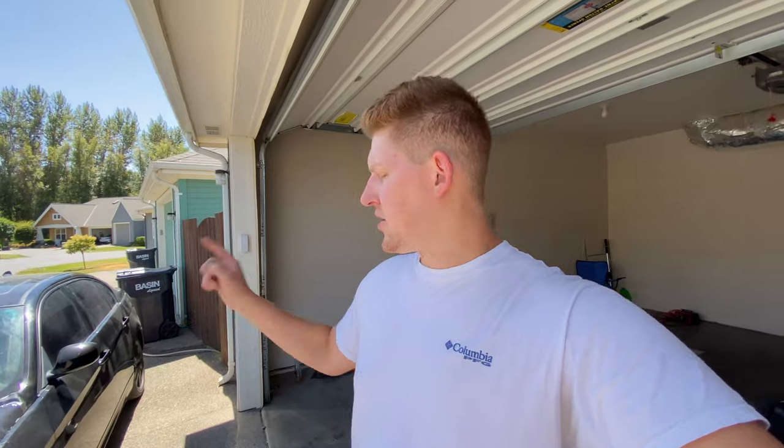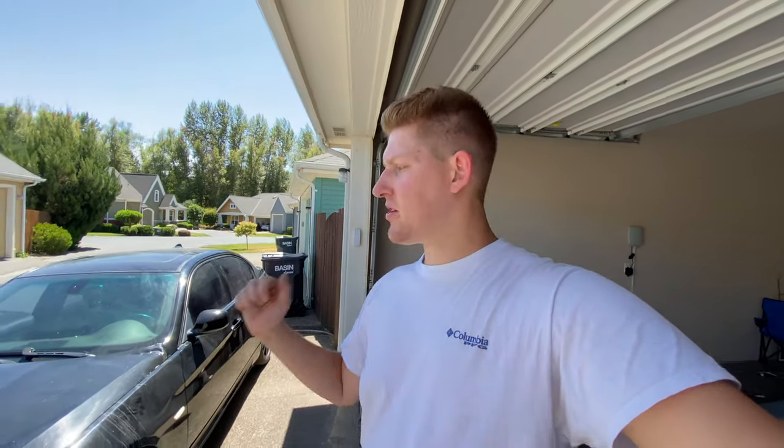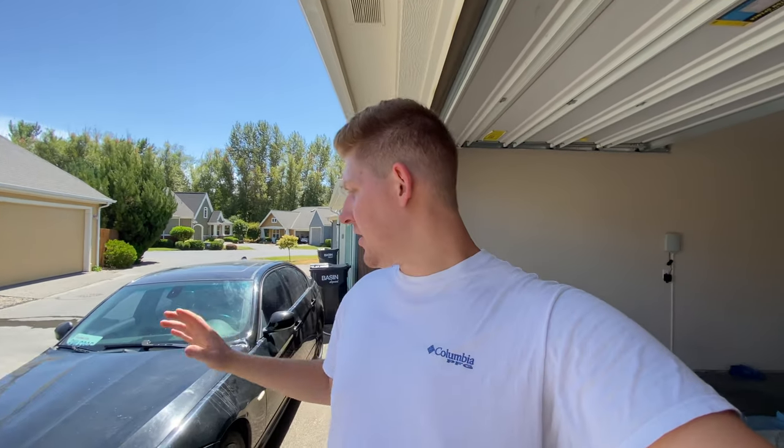Since the last clip I've checked fuel pressure to make sure the system is getting good fuel pressure, checked all the connections to the fuel pump, and checked all the fuses. Now I'm going to give this car a quick wash so that if I break down again at least it looks nice, then I'm going to have my buddy follow me with an SUV so he can tow me if I break down. I cleared all the codes and I'm going to see what comes back when the car fails so I can figure out what's causing this — or maybe it was just a simple loose connection that I already fixed.